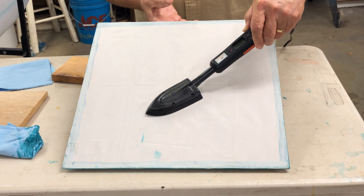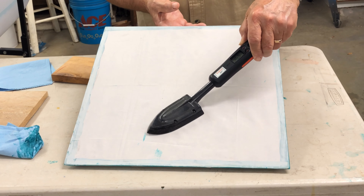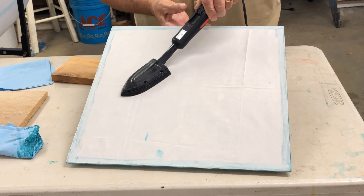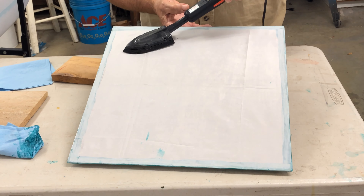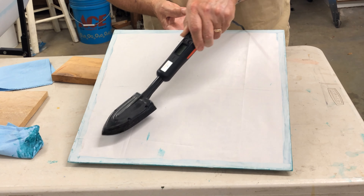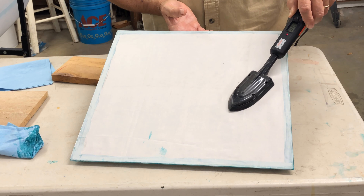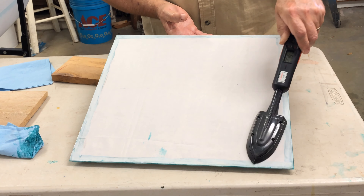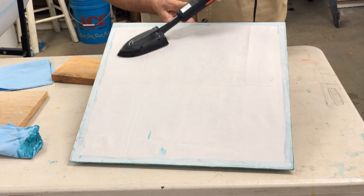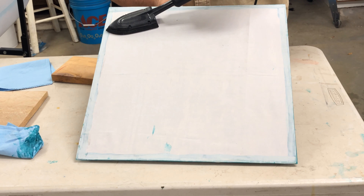I've got the iron set at about 250 degrees. I'll start in the middle and work around slowly, giving the fabric time to actually shrink. I'm holding the iron there and just moving it slowly, allowing it to shrink. At 250 degrees I don't need to go higher yet — initially I'm just trying to smooth out the fabric and get it to lay flat on this surface. This panel is very flat. If you have a panel that's a little concave or convex, don't shrink it too much or it'll lift above the low spots and be harder to bond later.